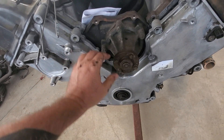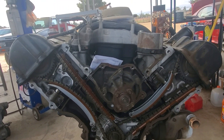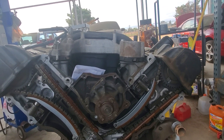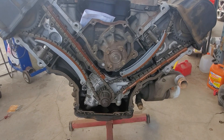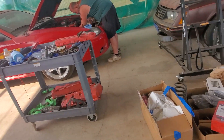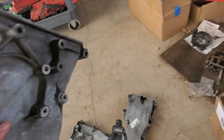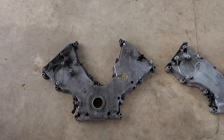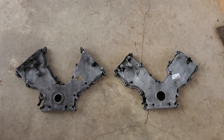Here's another motor already pulled apart — this is all new stuff for the two valve, and like I said it's pretty much identical, and a lot easier to put together. Now looking at the timing cover difference — a lot of people ask what's the difference between the timing covers — so here we go. That's the two-valve one and this is the four-valve one. If you can see, it opens up a little bit more on the top — that's the difference right there.